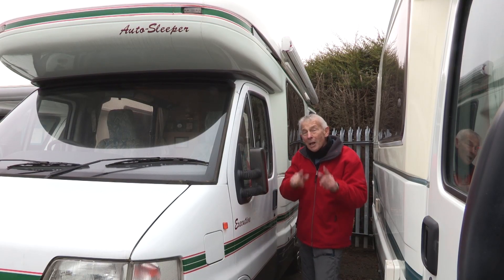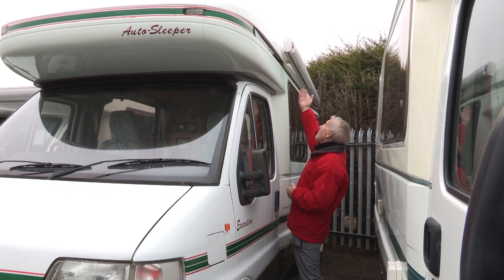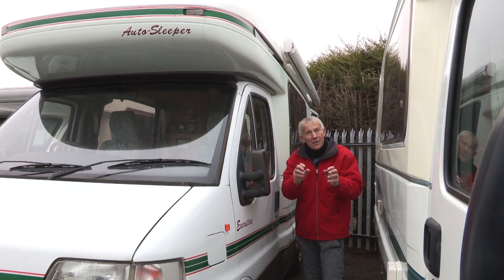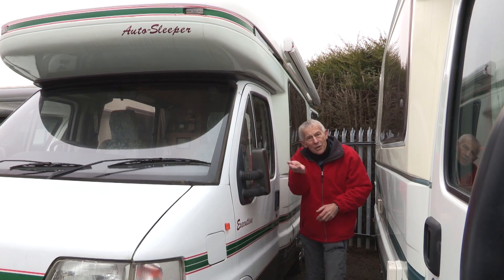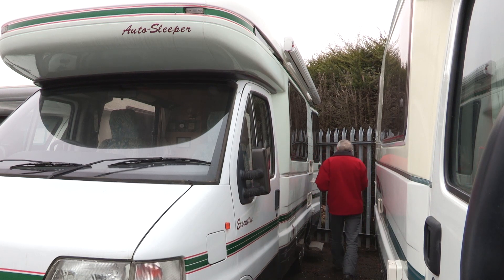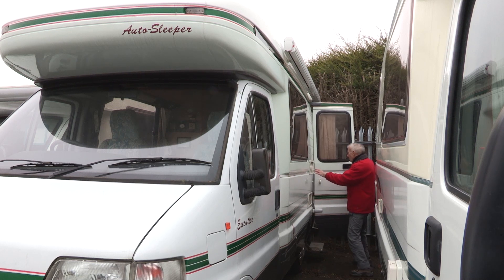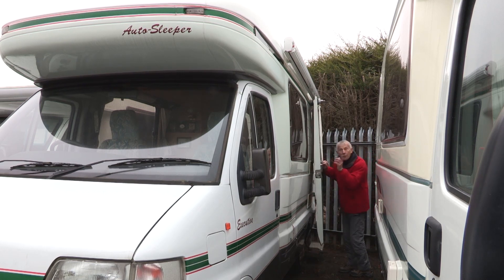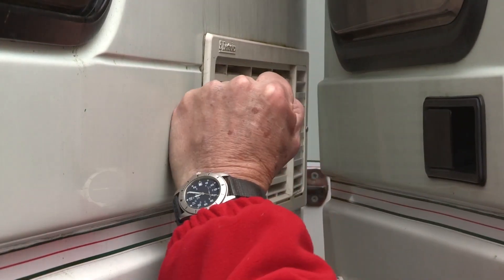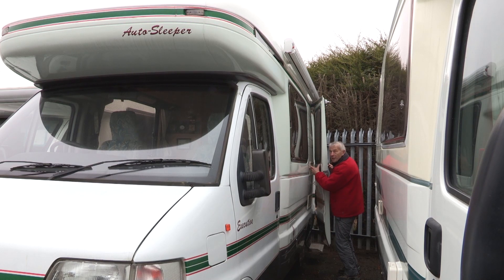Back down to terra firma, I have noticed something. I like to see a sun blind, and there it is up there, but doesn't it project? On modern vans, it's usually mounted within a recess. Going inside — I've just noticed something. That is completely obscuring the vent. That fridge isn't going to work properly, and I'd want to see a little modification to make space there.